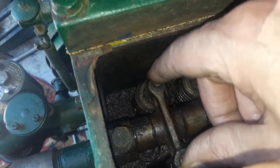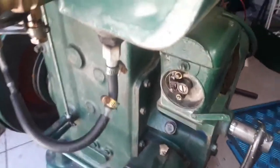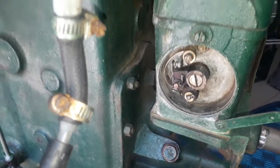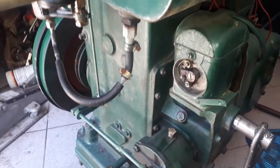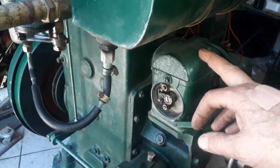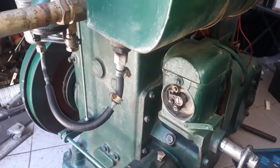This is the outlet, this is the play and inlet. This one feels okay but this one feels too big — the gap. Now for spark: I've taken this cover off, sandpapered the points, and checked for spark on the spark plug. There's zero — like zero, zero, zero spark. Something is now wrong again. I'll have to take the tank off again, clean up inside, measure this again, and see why there's no spark. Totally dead.